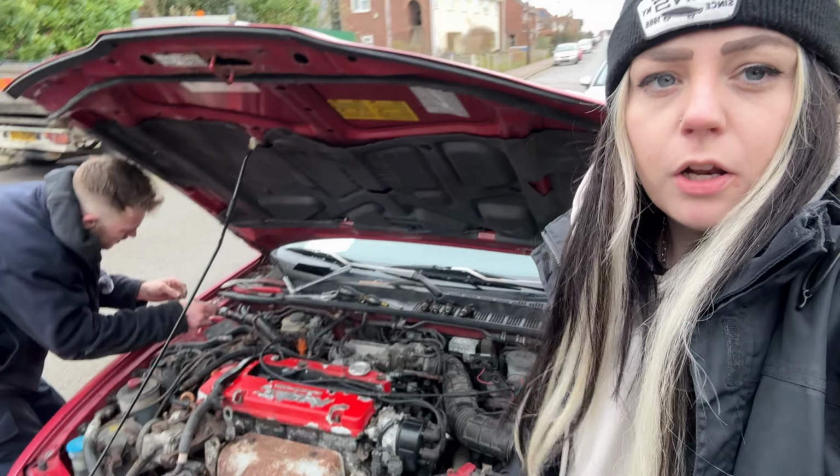so yeah, I'm just gonna sit and wait. Charlie is taking the fuel rail off so that we can put my other fuel rail on, because the injectors on that one work, whereas one of the injectors on this one doesn't work. And I would just swap the injectors over, but your fuel rail's been stripped and cleaned. Smells fuely in here. One plug, two plug, three plug. It was a little bit harder to get to. Can't really get it out.